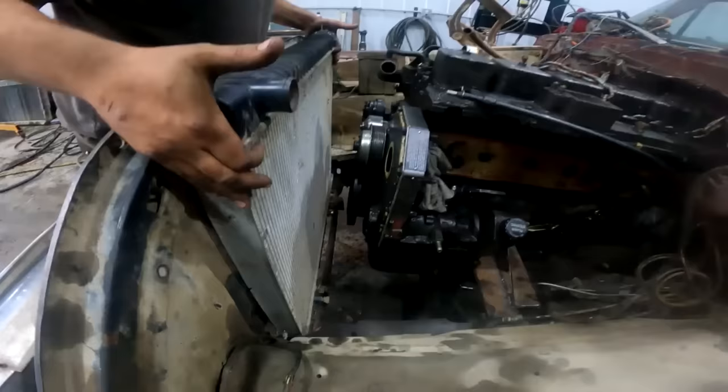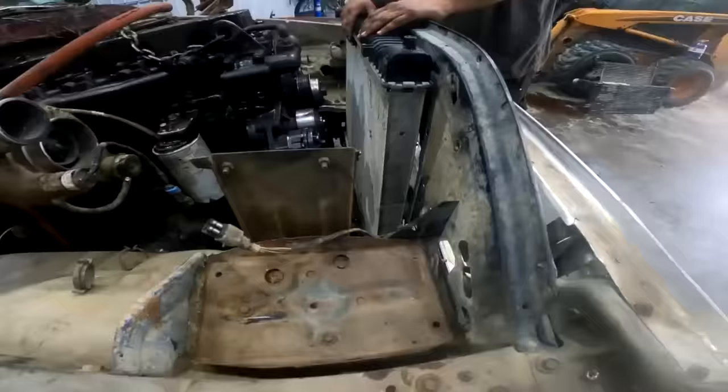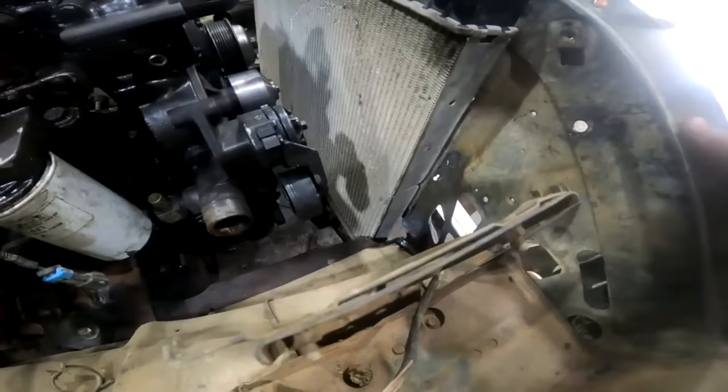And then they couldn't mess that up because there's no wiring in it. The bottom one, we're gonna have to get a little bit creative with the way that we fiddle in the water neck, but that's no big deal. And we checked out an intercooler out of a '99 to '04 Power Stroke, and they are the exact distance we need, so we can blast a hole here and a hole over there, and then bring the intercooler piping right through there. So it'll be minty as she'll have an intercooler on her.